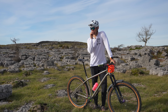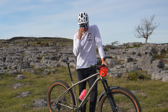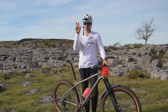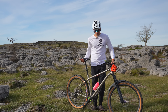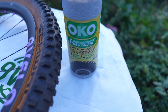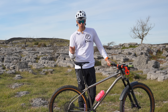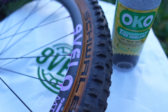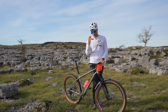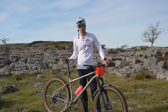Coming on to the tubeless tip: I refuse to buy Stans sealant at $20–30 a quart — it's an absolute rip-off. Mountain bike and road bike tubeless sealant is overpriced, and don't forget tubeless tires were invented way before mountain bikes adopted them. In my professional engineering career I work a lot with OTR — off-the-road — vehicles like mining trucks, and we use a stuff called OKO. OKO has been around for ages — it's tubeless sealant with lots of rubber and cotton particles in it. It's quite thick so I dilute it on the mountain bike with water or a bit of antifreeze/glycol so it gets around the rim tape and seals those little holes. It's about three or four times cheaper than mountain bike-specific sealants like Stans, PTS, or Muc-Off, and I think it works a lot better.